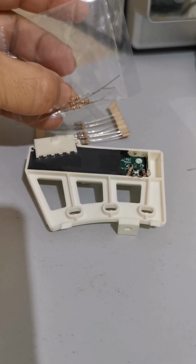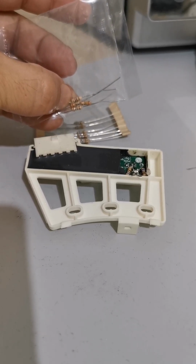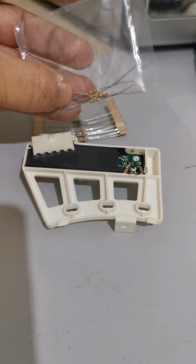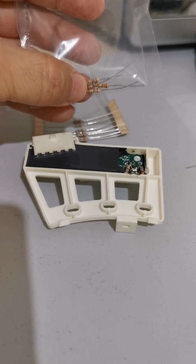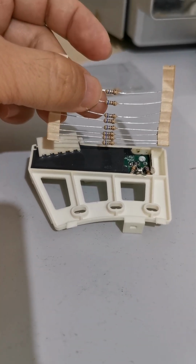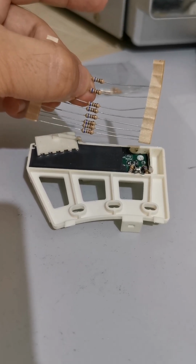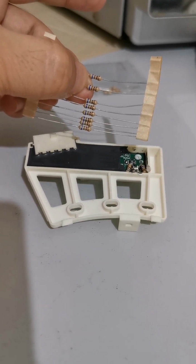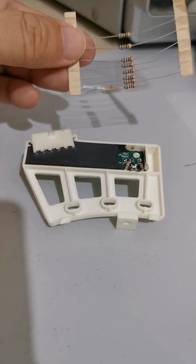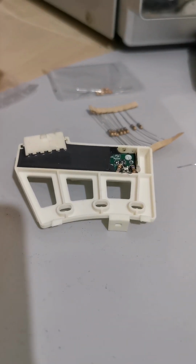With two pieces, you would just buy one 240 plus one 100, equal to 340. But in the resistors world, it doesn't work this way. You have to buy a 680, two pieces in parallel, divided by two, equal to 340 value. So in this video, I learned something.